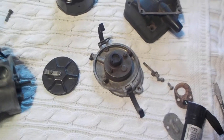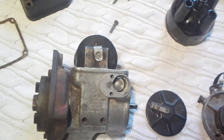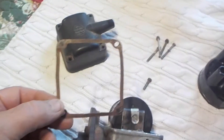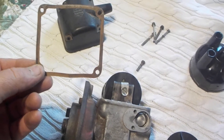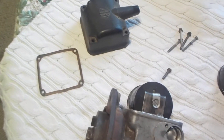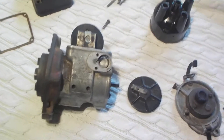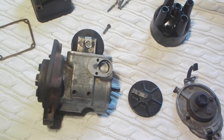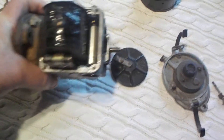When you're looking at the magneto, obviously this is the cap — it goes on the top here. Four screws off, unveils the coil. Now, I want you to notice that in every place where metal comes into metal, there is a gasket. Very, very important. Because moisture is the killer of anything electrical. Moisture gets in there and you're not going to have a good spark.